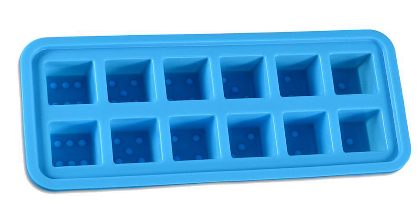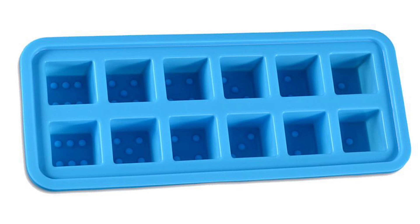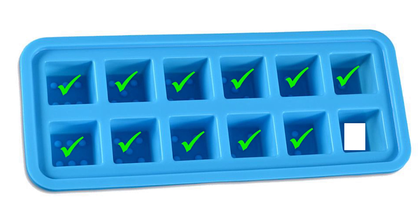Let's look at it another way — think of it like an ice cube tray. Let's say you have 12 spots for cubes. If you fill all 12 of them with water, the tray would be at 100% capacity and you would have 12 ice cubes to work with. However, if one of those cups got a hole in it and you could only fill up 11 of those 12 spots, then by filling the 11 spots you would still be at 100% capacity of the tray, but you would only have 11 cubes. So while you may read 100% full on your fuel gauge, if you have 11 bars of storage capacity you will have less energy available and therefore not be able to drive as far. It's truly as if your fuel tank is shrinking as the vehicle ages, and this is the essence of battery degradation — common throughout all electric vehicles.